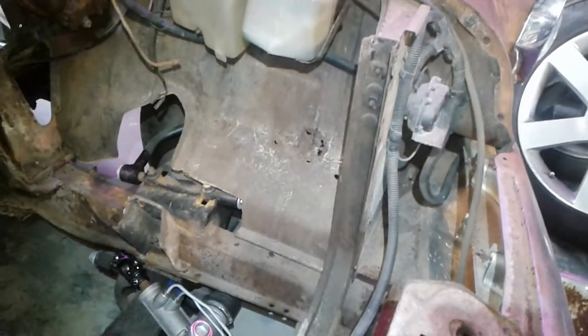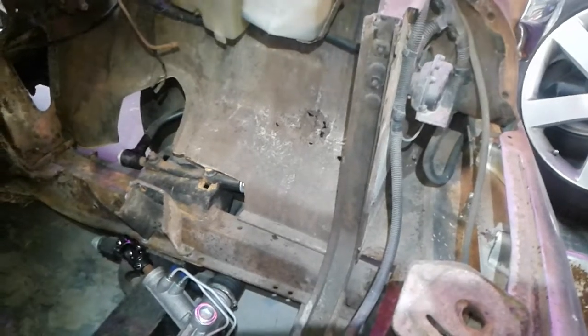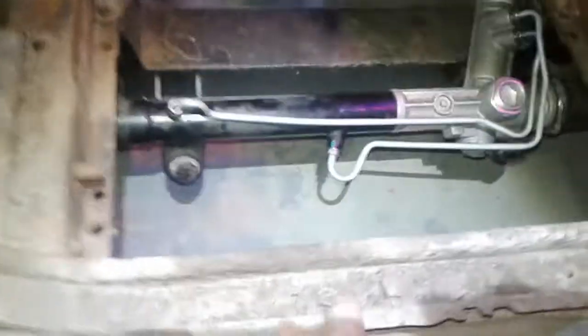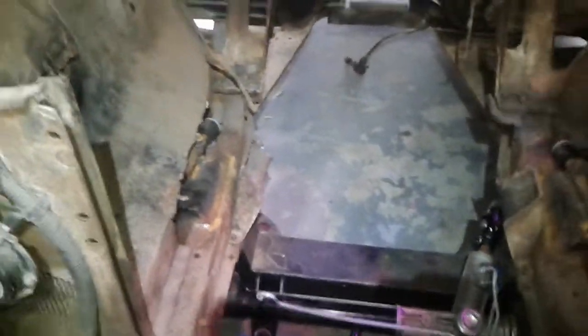So what you need to do, Andy, is put your lower core support back into your truck. That's what's going to hold up your front clip and give everything tightness where it bolts down to the center. You need to have that back in — don't leave it out.